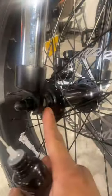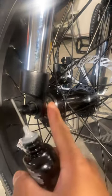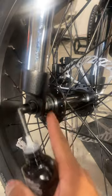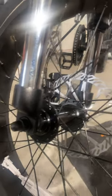It comes from this rubber here — it's a dust cover. Because it's plastic, it just rubs against the metal and makes a little whistle. All you need to do is add a little bit of oil here, like this much, and then all the noise will be gone.